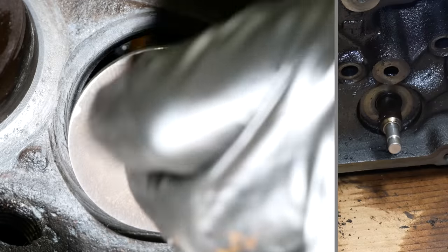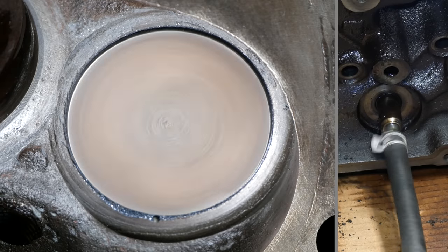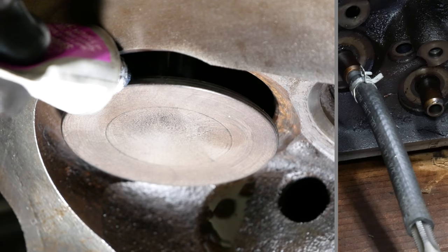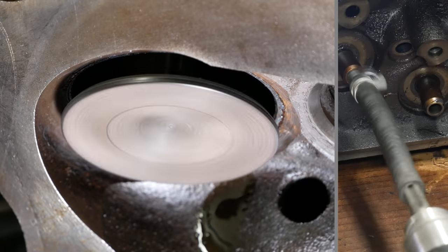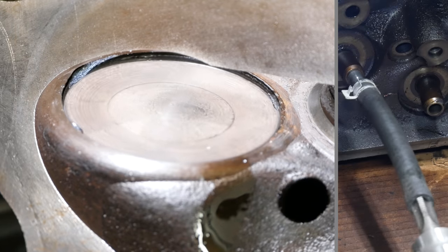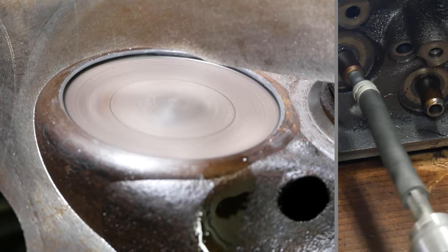It took quite a while to get through all of the valves on one cylinder head, but we had to pay attention and make sure each one was just right. Here's a closeup of an intake valve going through that same process. These have a more narrow seat, but since the valve itself is larger, the surface area is pretty comparable. In this case, the intake valves were the particularly rusty ones, so they needed a lot of time. Part of this is due to the location of water ingress, and part of it is because I believe the exhaust valves are stainless while the intakes are not. In most cases the valve seat was looking good before the valve face was. These seats are hardened — I believe it's some sort of induction hardening process — and hopefully that hardening is deep enough that we're not grinding it all off.